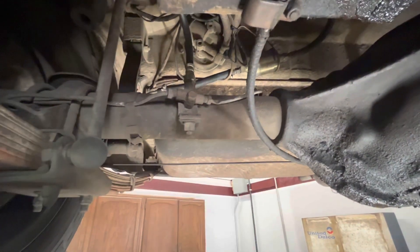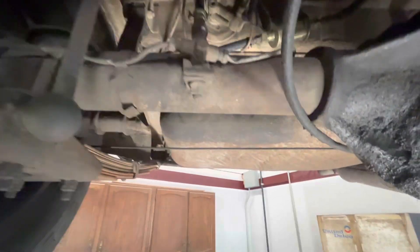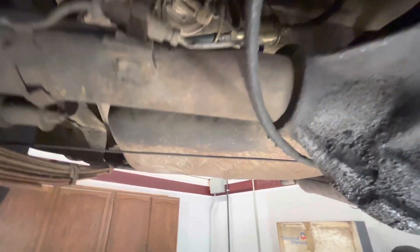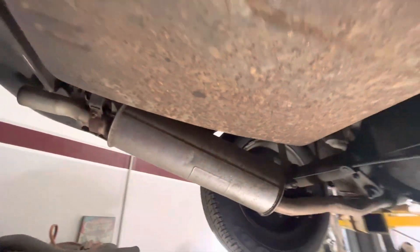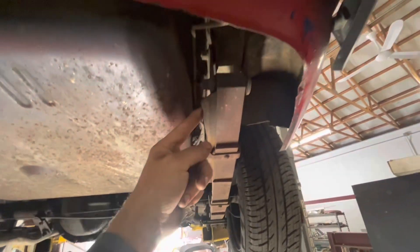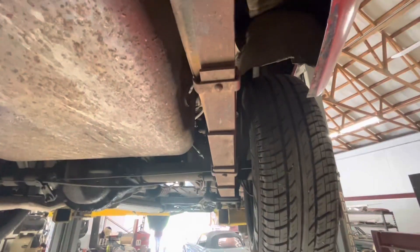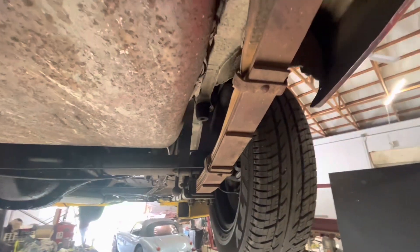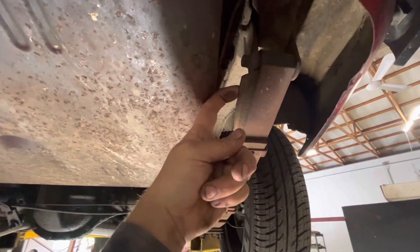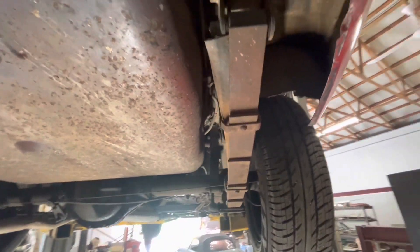The thing's obviously been towed before and had a hook or chain wrapped around here, so that's been crimped off a bit, meaning the left rear brakes probably aren't doing a whole lot. The tank looks pretty good. Stuff like this is fairly normal — you see that all the time. It's there to keep the springs quiet but we can fix that.